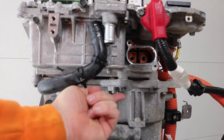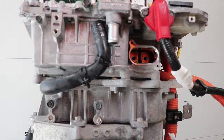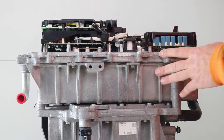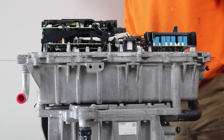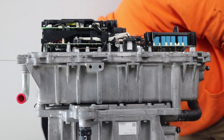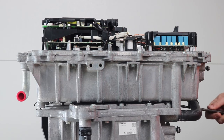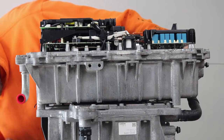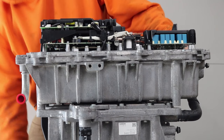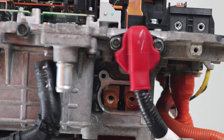Now I can start working on these 13 millimeter bolts that go up and hold the charger on. We have the bolts out, but it looks like there are also some alignment pins under there. So I'm going to try to gently pry it up and do it kind of nice and straight and gentle. Over on this side there's an alignment pin, and of course make sure you get those connections down to the inverter. Try to lift this straight up so we don't damage any of these connections.